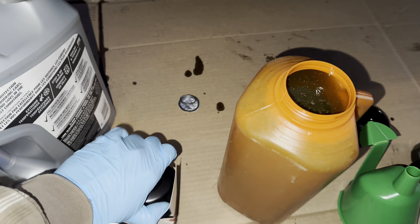I don't know what's going on with my neighbor here but seems like they're cutting something. Now we're gonna go ahead and fill my 3-liter container so it's accurate. Just for reference guys, we're filling this car with 4 liters — this car only takes 4 liters including the oil filter. This is not sponsored by Valvoline, hopefully Valvoline will sponsor us in the future. We're using 5W30 as the manual's recommendation.